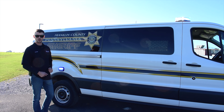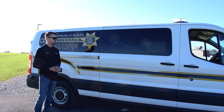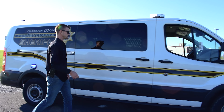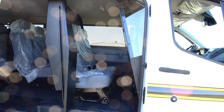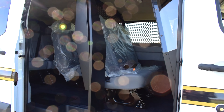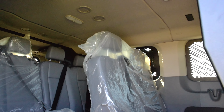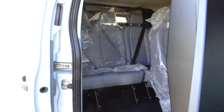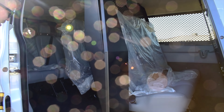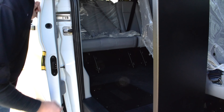So we're on the other side of the van. We're going to go ahead and open up this side sliding door and show you inside the vehicle how this van was set up and what we did to upfit it for prisoner transport. This van was provided with the seats inside — the second, third, and fourth row seating. We have the front, middle, and rear partition, as well as the window bars, due to the fact that this Transit was provided with the interior seating and the full windows on the sides. We also removed the 30% seating here to the left inside the van so you can get access to that rear row.